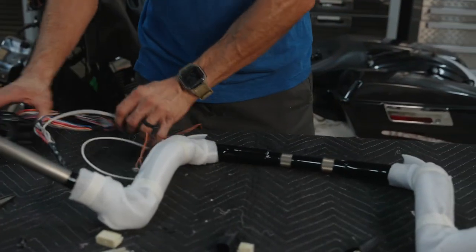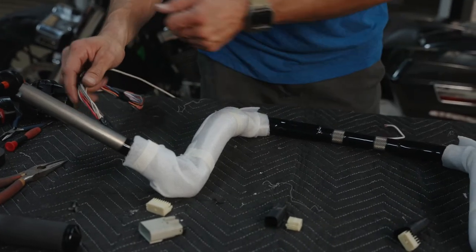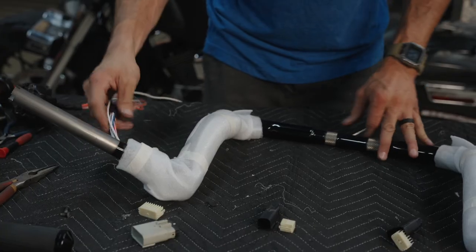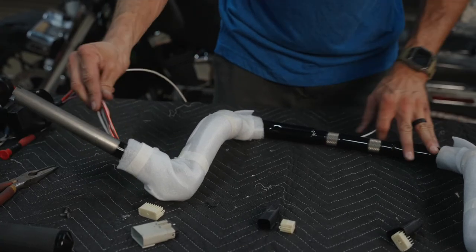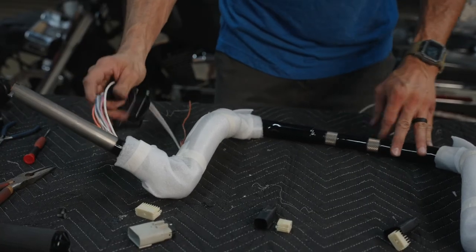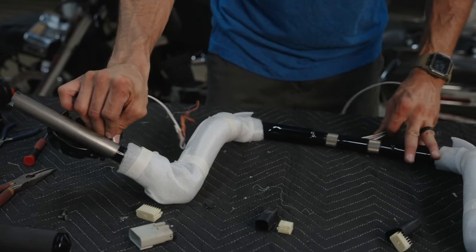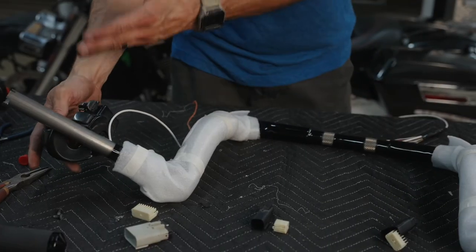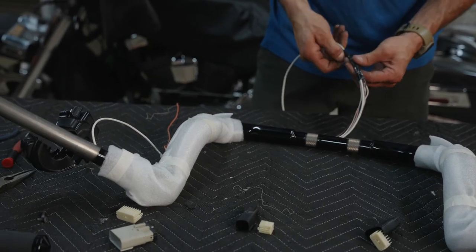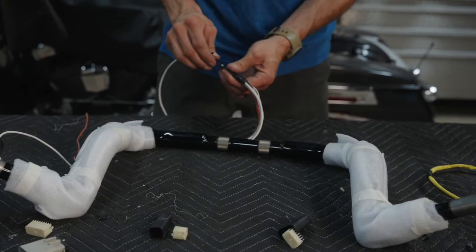I don't recommend making this tape job bulky. I like to start two or three inches from the end of the harness and just do a nice tight and light tape job. You want everything as thin and skinny as possible going through the bar. We like to do a push-pull method: push the harness in the bar and pull the slack out. If you try to just grip it and rip it through the bar, you're going to skin your wires up or break a pin off. These go through nicely — if you feel like it's rough inside, it's just some weld penetration. One of our big quality checkpoints is making sure the parts are deburred before they're welded together.